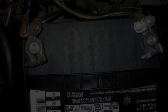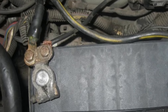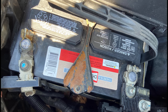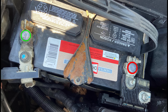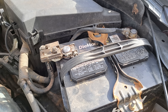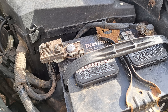However, if everything on your battery is plain black, look at the battery itself. Oftentimes the positive and negative terminals will be marked. If you can't find any markings, the positive terminal will usually be slightly bigger than the negative to prevent you from crossing the wires over when installing a new battery. Also, the positive side will usually have more wires coming off of it and they will be thicker, while the negative side will have less and they will be thinner.